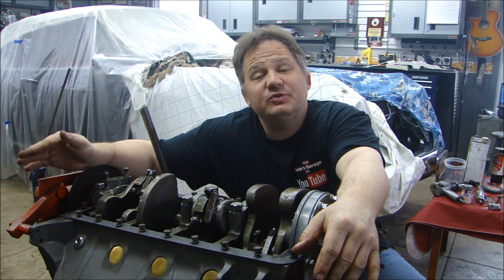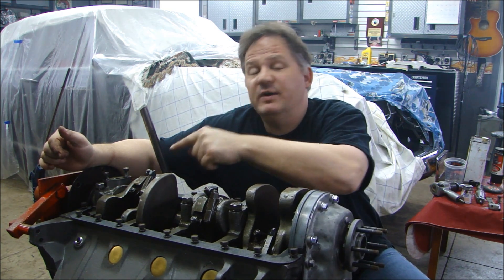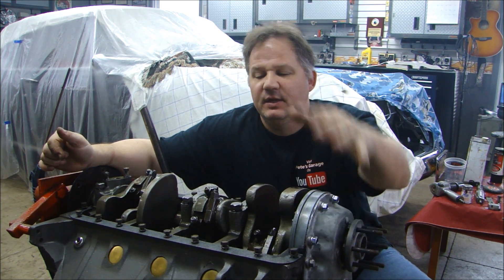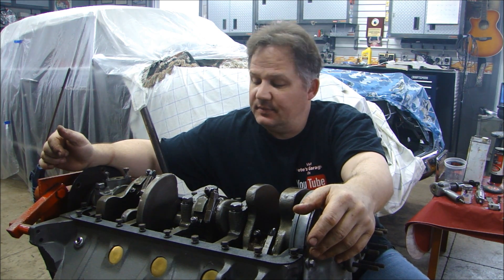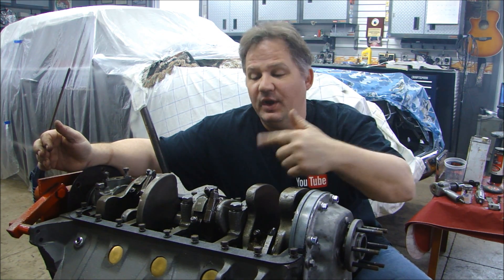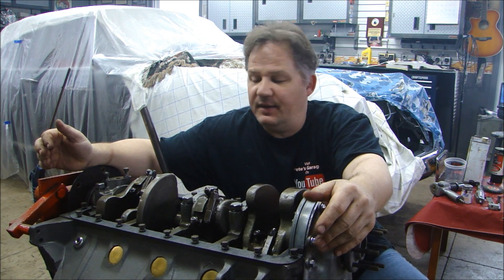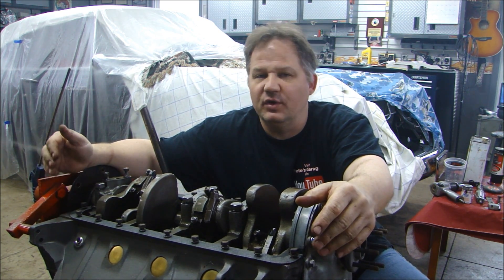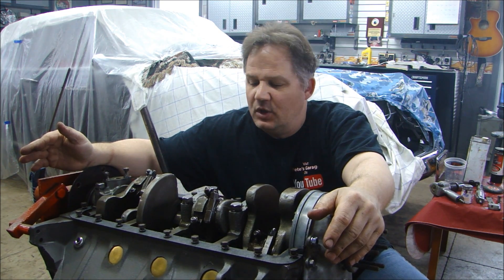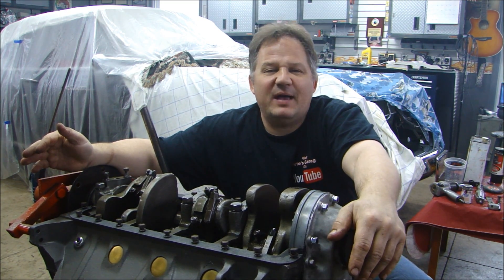Okay, we're always getting closer and closer. Next we've got a lot of stuff to do. I think next what we'll do is rebuild our oil pump and install the oil pump - that way we can put our oil pan on. It would be stupid to put the oil pan on without rebuilding the oil pump and getting the oil pump in place. And then make one last rotational check of the engine, make sure everything's alright before I button up the bottom end. Then we can flip it over - there's a lot of stuff to do: fuel pump, all the other stuff on the top. We'll do that when we come back, get the front end bolted up and get it ready to roll. Thanks for stopping by Pete's Garage. We'll see you next time.